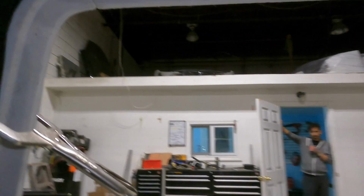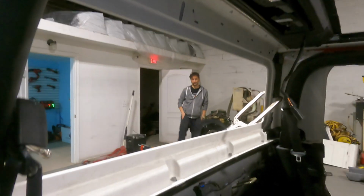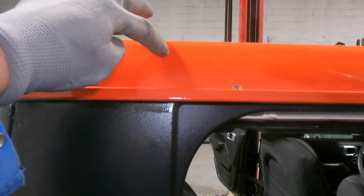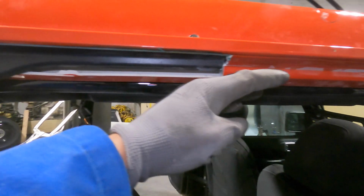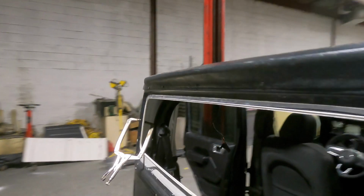And reinforce the insides. Bring these plates. Just gonna glue it in right now, both sides, and that's gonna strengthen the roof. We also went ahead and glued this piece to the outer cap, and now the fiberglass guy will just blend this in. He'll strengthen the back first, and that's that.